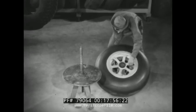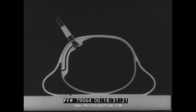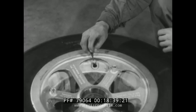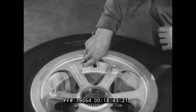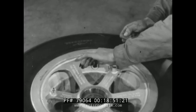Dismounting and mounting a nose wheel tire with a dual seal tube present a different problem. The dual seal tube has an outer and an inner air compartment. When the tire is inflated, both compartments carry the same air pressure. Then the valve core housing with its tapered rubber washer is screwed down tight and seated firmly. This seals the air in the inner compartment away from the outer compartment. To deflate the tire for dismounting, first remove the valve core. Then the core housing is unscrewed five full turns. This lets the air escape from both compartments at the same time.